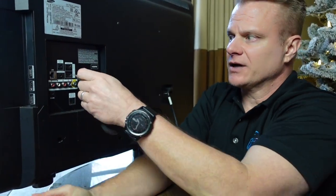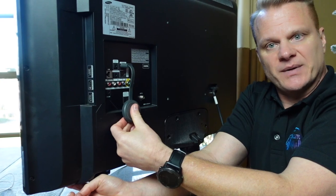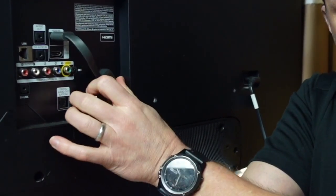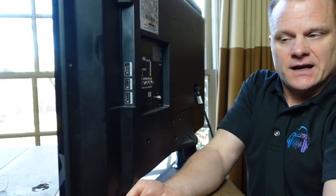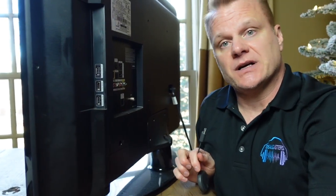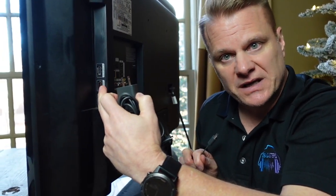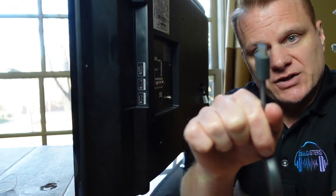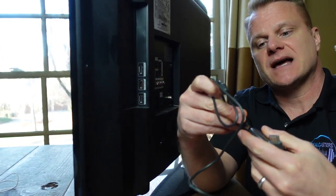This is your HDMI in — you're going to plug it into the HDMI in. In this case I'm using number two on this particular television. You can see it doesn't take up any space, so if you've got something flush against the wall, this will just tuck right in. A lot of people will have an HDMI on the side of the TV, which is also a good option because you may have a USB input as well. You can plug the Chromecast into the HDMI and plug the power cable right into a USB, and then you can put the power adapter in a drawer or use it for something else.